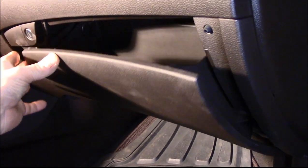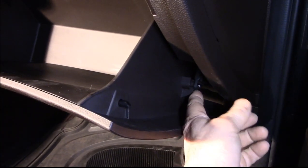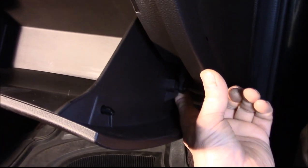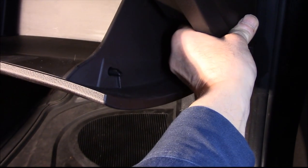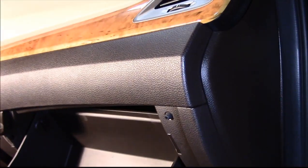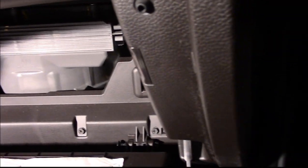Now we're inside the vehicle. Just open up the glove compartment and of course take all your stuff out of there first. There's a little clip right down inside here — you just take this clip and pull it off to the side. You can do it with your finger, you can do it with a screwdriver, whatever works for you. Then you'll see there are little clips up inside the glove box. You just take this, turn it and take it out. We'll do the same thing on the other side — just take it, turn it, and then the glove box pulls down.